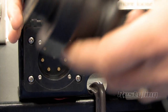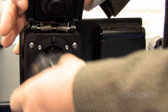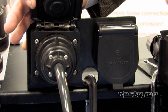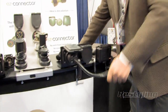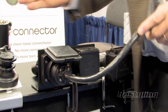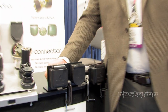The connection is very simple — even in the dark, without looking. You just stick it in any direction, take the index, and rotate it until it's to the top, and it pulls itself in. You can literally hear the contacts come together. In the roughest conditions, going down a rough road, this thing is not going to shake loose. You always have a good signal and good brakes. Yet in the event that you drive away inadvertently — even if installed inside the sidewall of a pickup — you can snap it out, drive away accidentally, and nothing is damaged. You didn't rip the cover or the wires; everything is still intact.